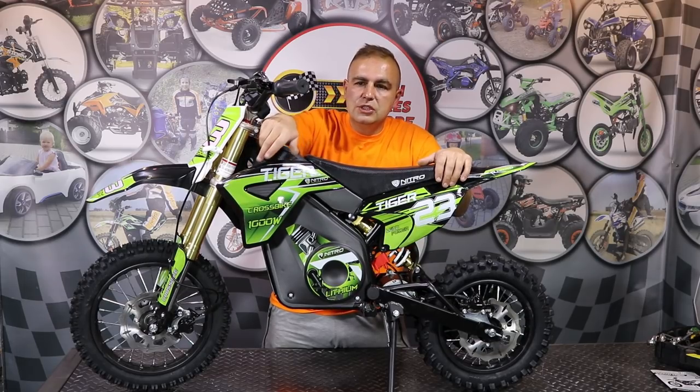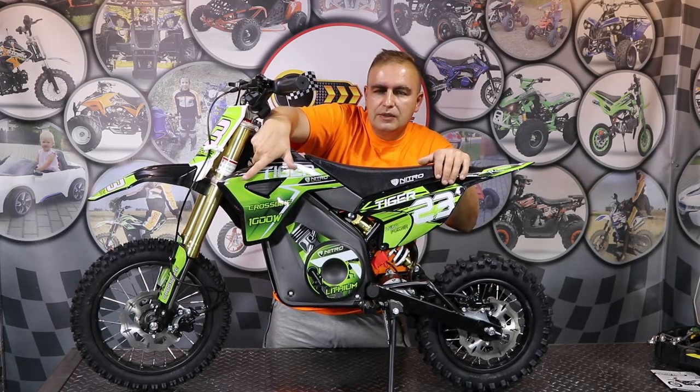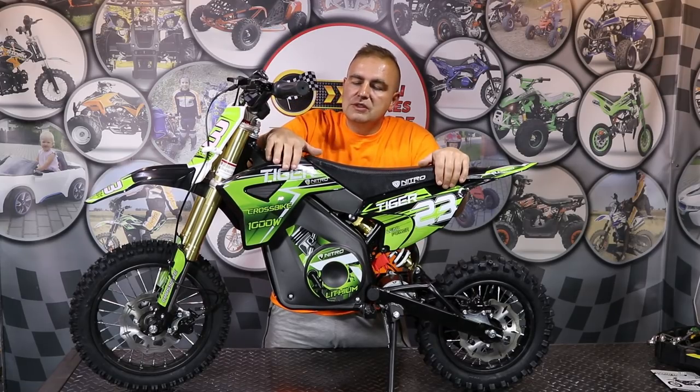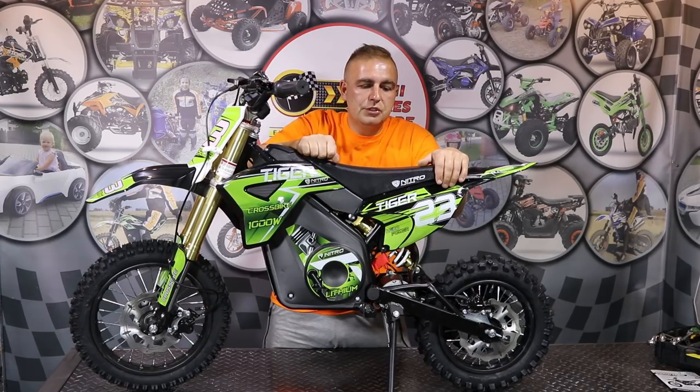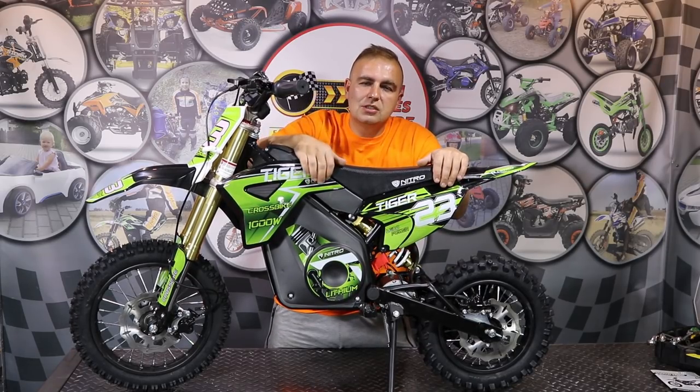So now the bike is almost ready to go. The first thing you have to do is plug in the charger - the charger socket is on the left-hand side here. Fully charge the battery and then you can use the bike. Remember to always keep the batteries fully charged - don't leave them empty. These are lithium-ion batteries and they are very sensitive to low voltage, so always keep the battery nice and fully charged. In the next videos we're going to do a review of this bike and we will also test it, so stay tuned, subscribe to our YouTube channel. If you like the bike you can purchase it from our website - the link to our shop is in the description. We deliver our products to 32 European countries. Thanks guys for watching and see you in the next video.